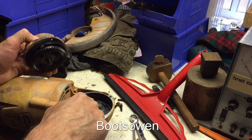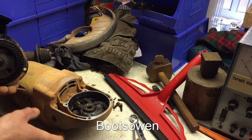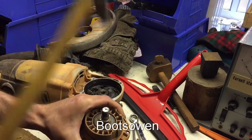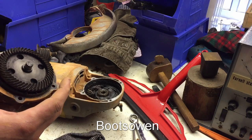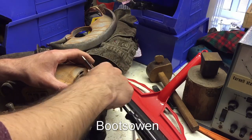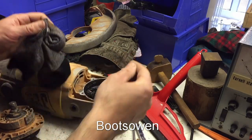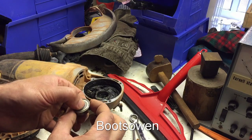Tap tap tap — it's not that bearing in there, that bit's dead. The gears are fine, suffering from a bit of a lack of grease. It's that bearing there — it's dead. This little bearing has just jumped out. The motor armature feels okay, the bearing in there feels okay. This is a 6000Z bearing — it's dead smooth but it's loose.